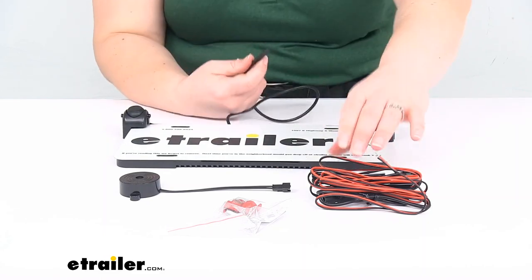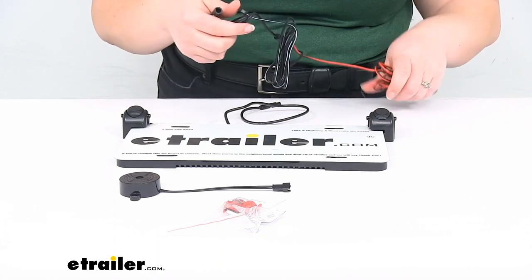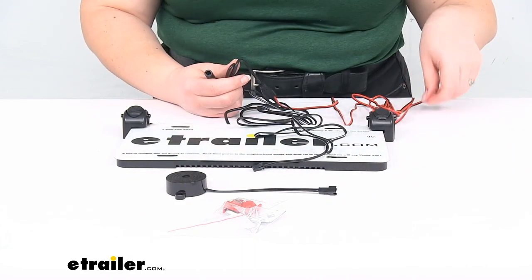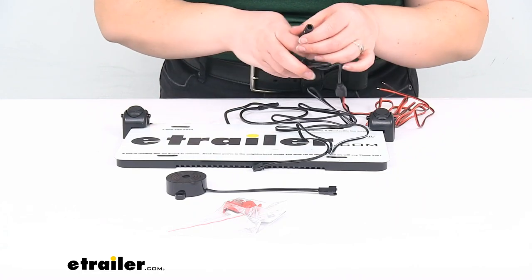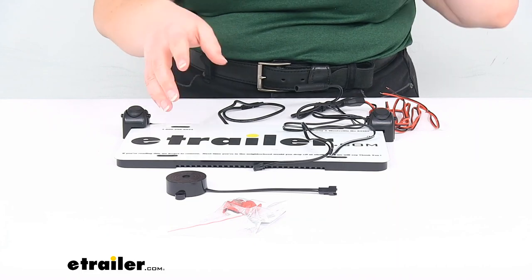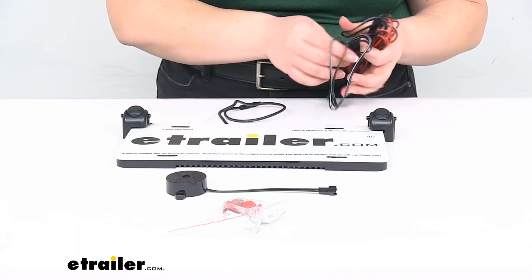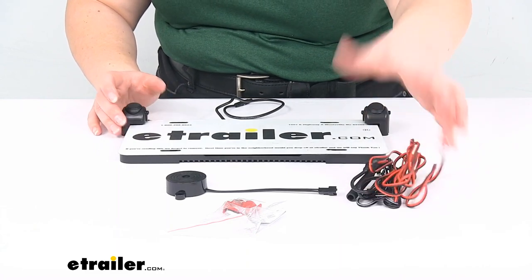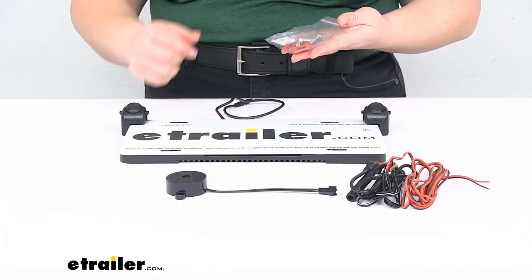You have your connection to make with the bulk wire — there are kind of two pieces to this. One that goes to your audible alarm, which is this little guy here. Then the other wiring gives you your power and ground: red is your power wire, black is your ground, and then it just plugs in. Make sure that you find a good spot for that alarm where it can be out of the way but you can still hear what's going on. It does have two settings — high and low — for the sound, so adjust it to your preference.